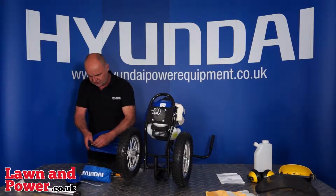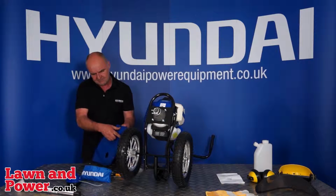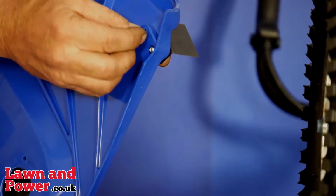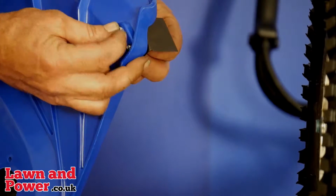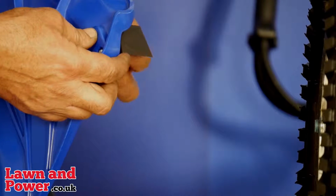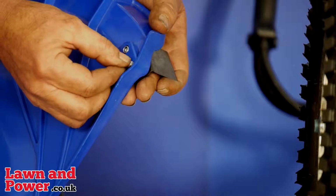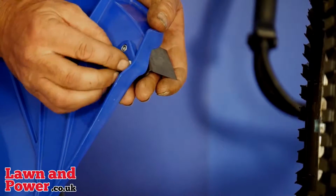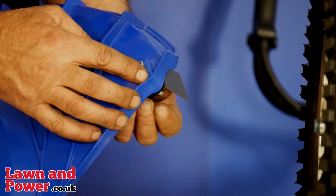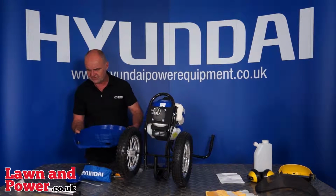So you'll need to put the 2 screws, the 2 you had left over, 2 identical ones, down through the holes, and on the back you'll see there are some hexagonal holes, which are exactly the same shape as the nut. The nuts will just drop into the little hexagonal holes, and there's enough there for you to just get the screw started in the nut. The plastic will hold the nut secure in the hexagonal hole. These are actually nylon nuts, and the little nylon portion needs to be uppermost so that the screw will start in the thread quite easily until it reaches the nylon. So that's basically in position.